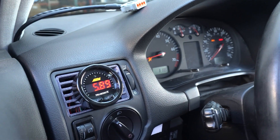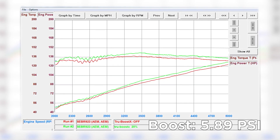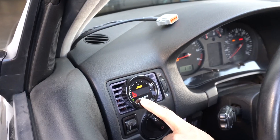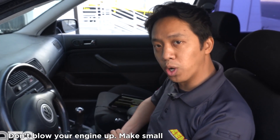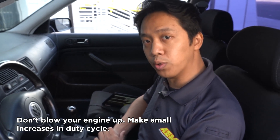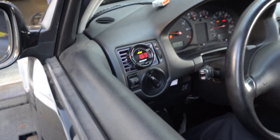Now that we're done with our second pass, let's hit the peak recall button to see what our results were. We got 5.89 pounds of boost, which is about a one pound increase over our wastegate pressure. From here we want to try our B setting, which is currently set at 40% duty cycle. Quick note — you probably don't want to do a 20% change in your boost control duty cycle. Your typical changes should be around 2 to 5%; you want to work slowly, but we know this vehicle pretty well and we also have the alarm function to save us if we get a little too aggressive.